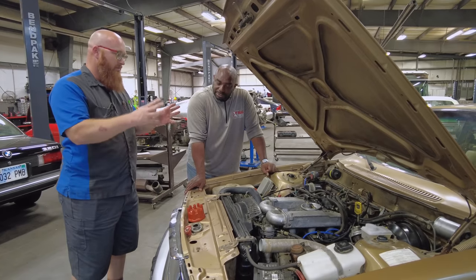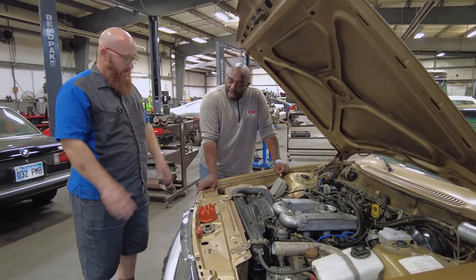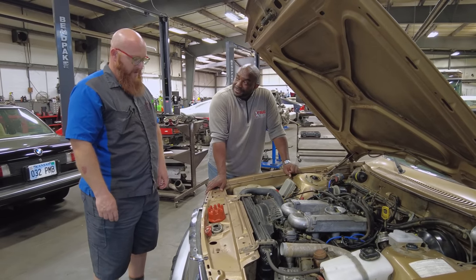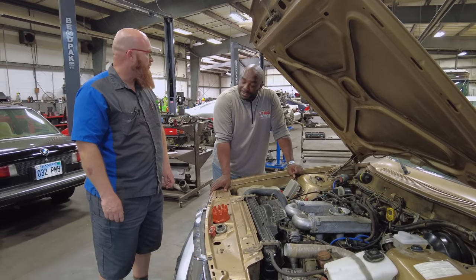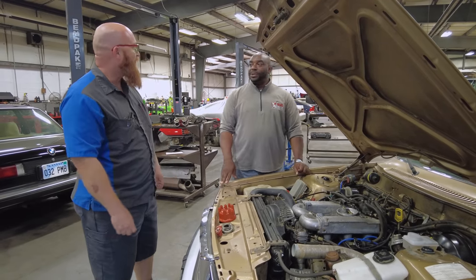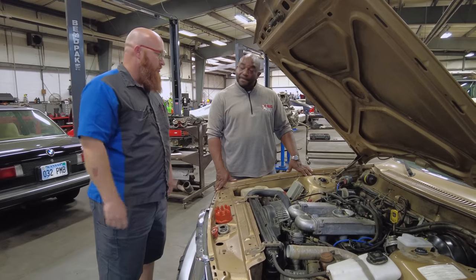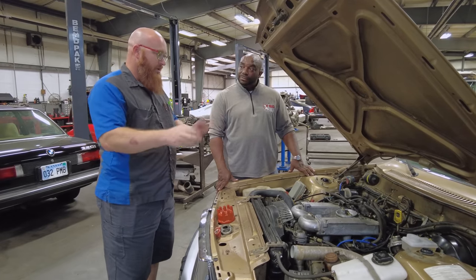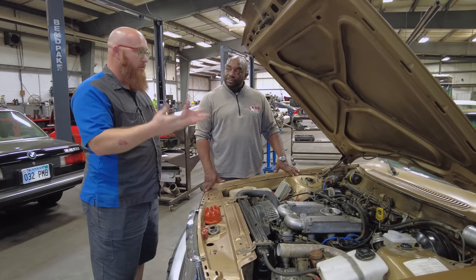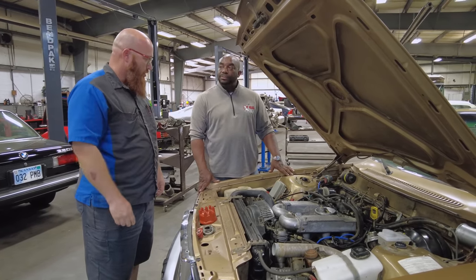Inside the cap there's a small black center portion — a graphite electrode. There's a protruding graphite electrode that's spring-loaded and supposed to contact the rotor. If I push on it, that's as far down as it'll go — there's just nothing left to it. Whoever did the tune-up probably broke the tip off or cracked it when putting the cap back on, since the distributor sits underneath the entire metering head assembly and is very hard to access. Eventually it gave way and was arcing across, cutting the spark power in half — barely enough to keep it running, misfiring at random.